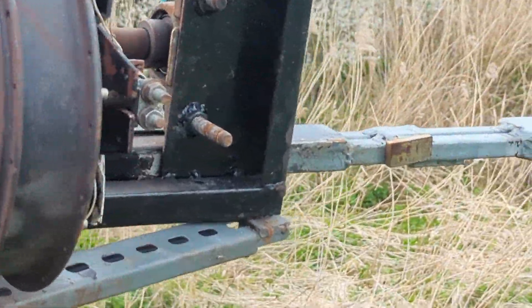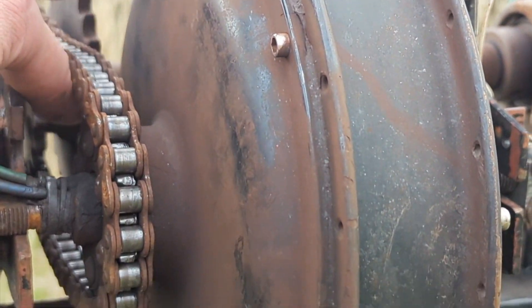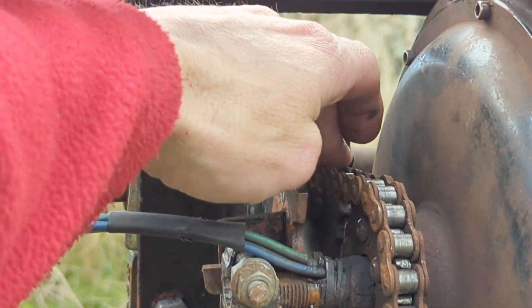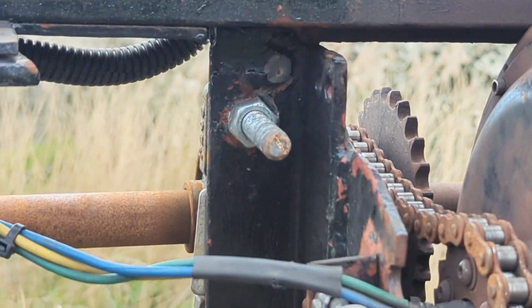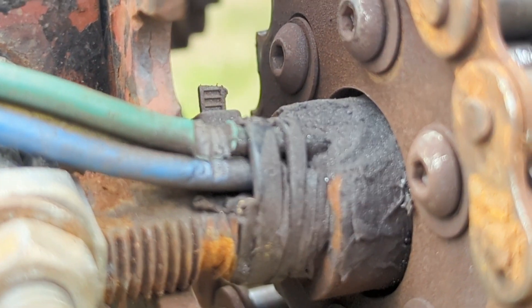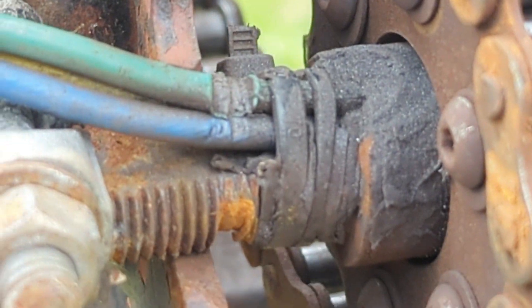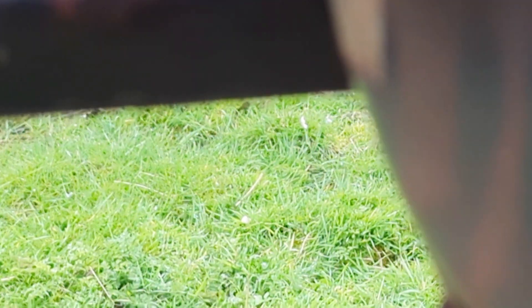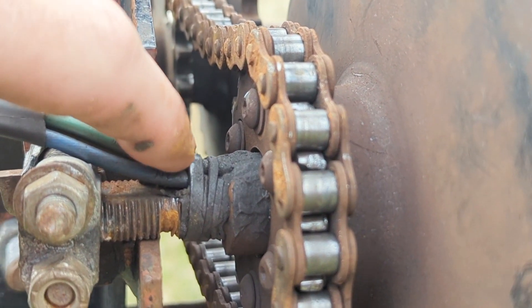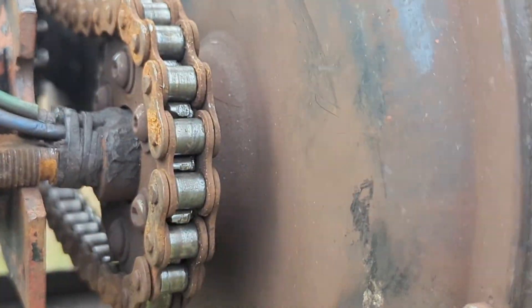So now that's on its side. The motor, you can see, is easily accessible. The chain's a bit loose, but that is not loose enough to come off — that works very well. If it's too tight, it doesn't work. Here's the problem I need to fix: that cable where it's been eaten away when the chain came off. One side of the chain has worn away through the wire, so it really does need replacing.